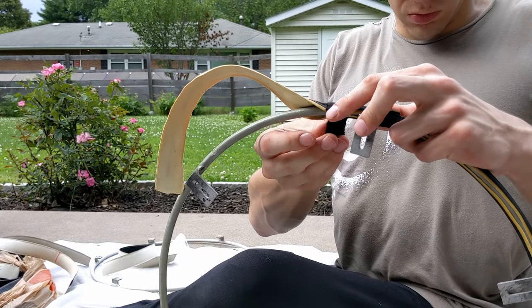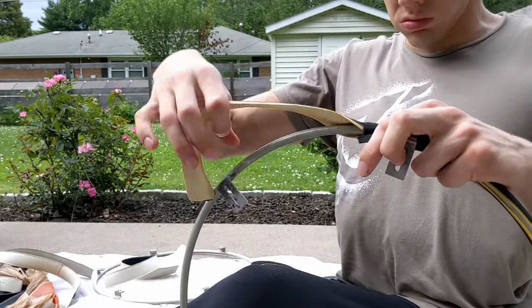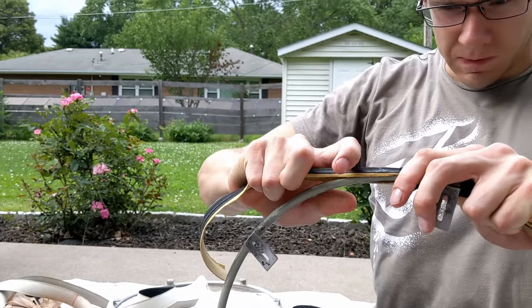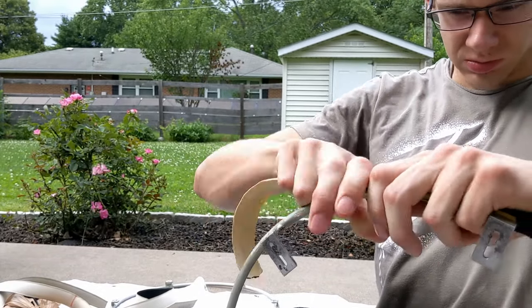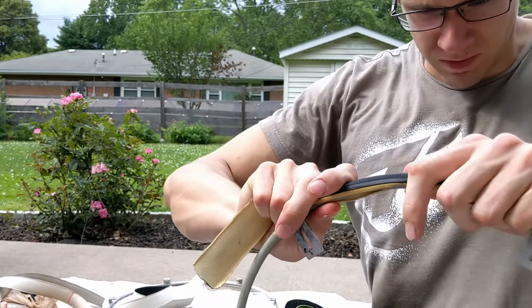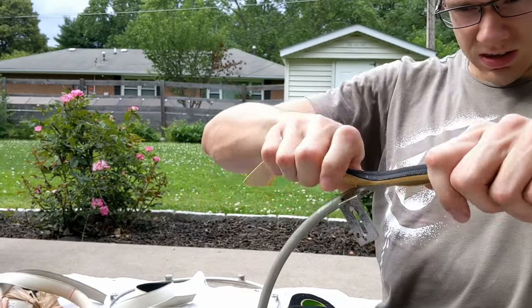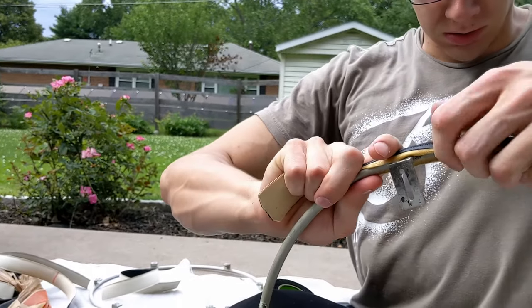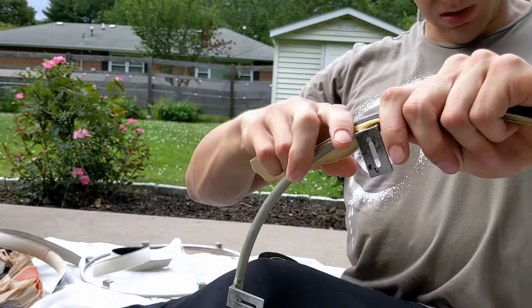Now pull and stretch the rest of the tire along the ring. That pulling will cause the tire to naturally curve around the ring, making it easy to apply. Notice you can handle the sticky part of the tire because it's mostly dry, but it will stick well to the ring because the ring also has adhesive on it.